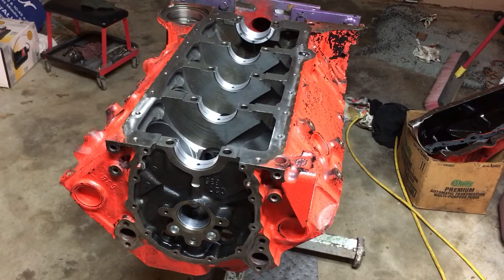So basically you pull your bottom plate off your oil pan, drive out a small pin, which releases the spring. You just pull one spring out, put another spring in, compress it, put the pin back in, and put the plate on. I think the torque spec on the oil pump bottom plate is like 7 foot-pounds.